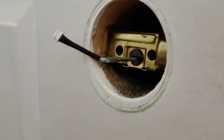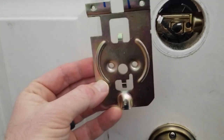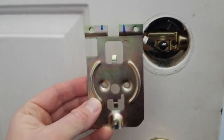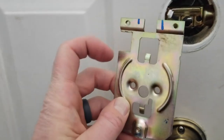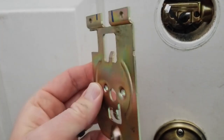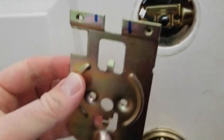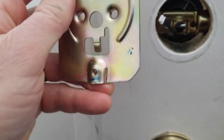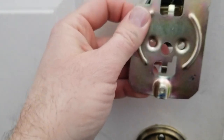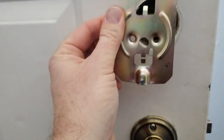Here's a picture from the other side — you can see the wire coming underneath the lock and the rod coming straight through that middle rectangle. Our next job is to place this mounting bracket on the inside of the door. This is the proper way to install it — you can see with these two markings. You're going to want to have this tab facing inward, and we're actually going to put that rod right through the middle. The wire is going to come down through this slot right here.